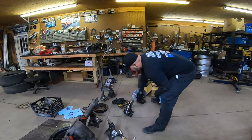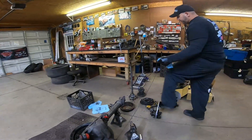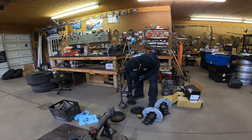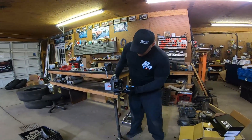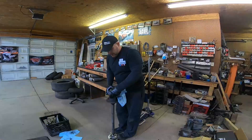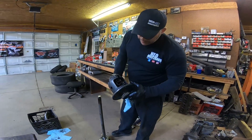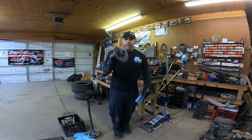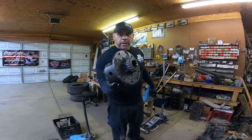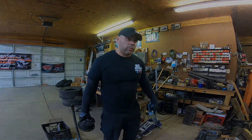This is an Explorer diff from the junkyard — I don't know how good it is, but we may use this one anyway. And you can see it's a 31 spline. This is one of those junkyard finds — a $100 carbon friction pack, 31 spline differential. Make sure you get the pin too. We're going to end up heading back to the junkyard to pick up one of these, and I'm going to take you along for that video to show you what you're looking at. You can not only get a diff, but you can get a gear set as well.